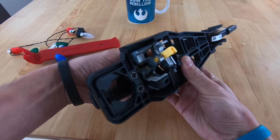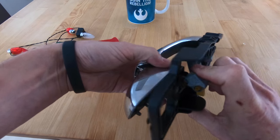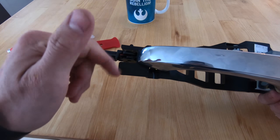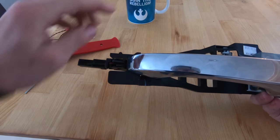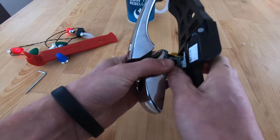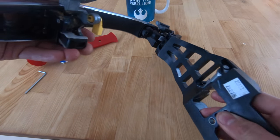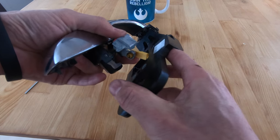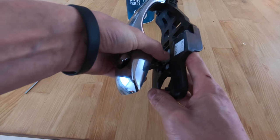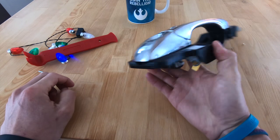But when you're removing the handle and pulling it out from the inside, you want to pull this down and it'll slide out easier like this. And you won't mess up the outside of your paint here. A lot of guys on the Jeep forum were saying they were scratching stuff up, and it's probably because they weren't seeing this portion of it. So they kept doing this and scuffing up their paint. If you just do that, you get it all in one simple motion and then it just slides out. Now the reverse, you just slide it back in. Easy peasy. As it comes down here, put the plastic piece through first and then push this little thing down in there. If you've got a hand on the inside, you can help hold it down and you'll get it all in there. No scuffs, no problems.